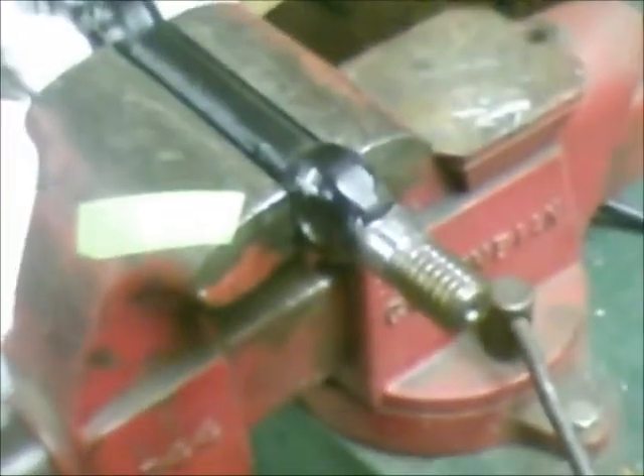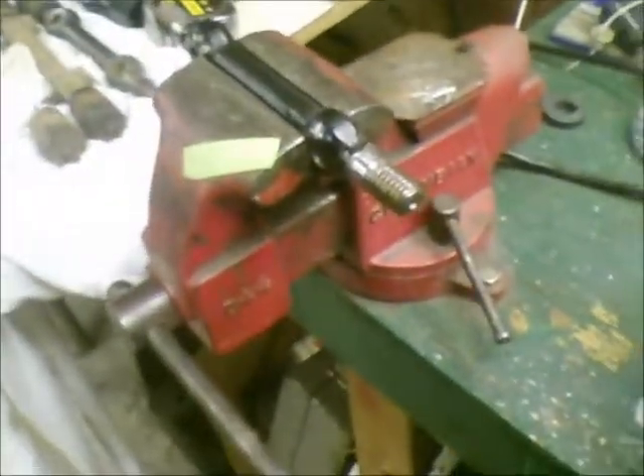You don't really want to grind too far on these. You don't want to take a lot of the threads off, but basically all you're doing is creating enough of a channel right here so that the grease can flow from one end to the other so that all of these threads get lubricated and nothing really ever gets dried out. It's recommended that if you drive the vehicle quite often, you do the lubrication on them again once a year, just like you do any other chassis or suspension components. There's a lot of depth to it and it didn't take very long at all — it's kind of like cheap insurance. It's not really going to affect the threads because once these things are installed, the thing's probably only flexed three quarters of a turn during normal suspension movement, so it's not like they're ever going to be tightened down and loosened up a whole lot.